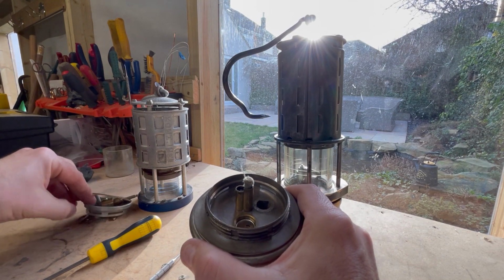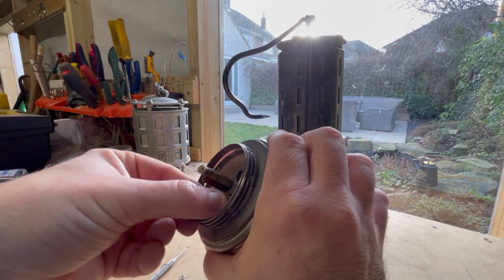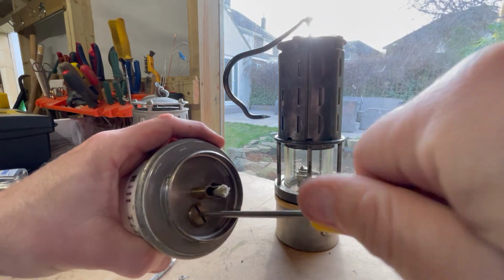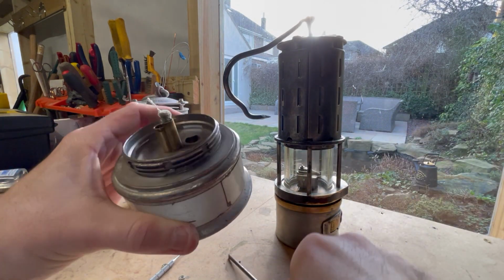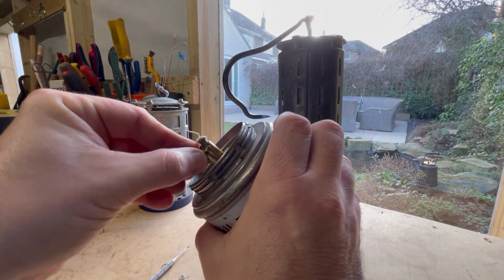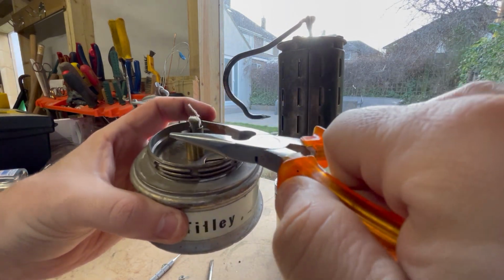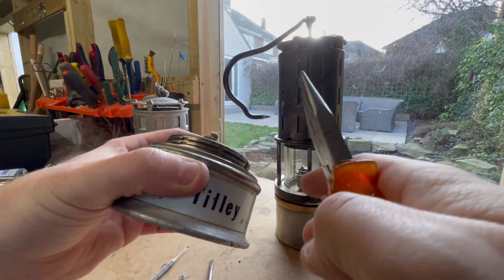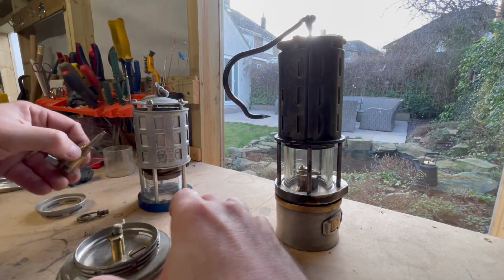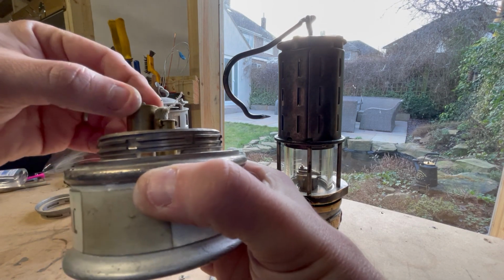And then put the O-ring in. And then put this stopper back on there. Let's just see if that'll screw in now. That cage, hopefully it'll push that little cage in further. Oh yeah, that's gone in alright. Then need to put that little cap back on there. And again, be gentle with that, but you should just squeeze on with these pliers. There, that's pushed on now. And that is basically how you change the wick on a Koehler, on these European Wolves.